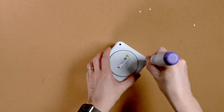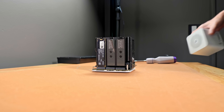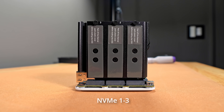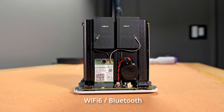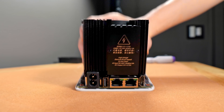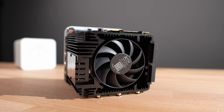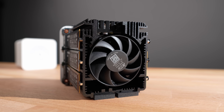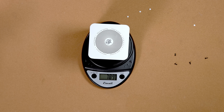I have no idea why they insist on including these screw protectors — they don't serve any purpose and I don't think they should include them at all. But once you get past that, the screws come out easily and the unit slides open. Inside you'll see six labeled NVMe slots one through six, a tiny internal power supply, and wireless and Bluetooth radios on one side. It has a surprisingly large heatsink in the middle, and you kind of have to admire the engineering — one large heatsink with the CPU, fan, and all of the NVMe drives attached to it with thermal pads with the chips facing the proper way. It's solid, it looks really cool, and I actually weighed it — it's pretty heavy.